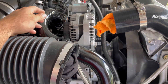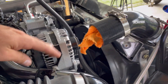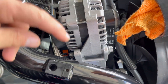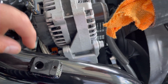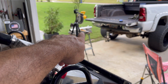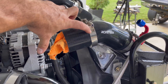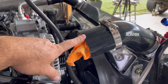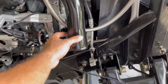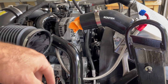They're all over the internet — they range from about 80 to 150 dollars. I'm going to cut that out and rotate it up. This MAP sensor is not going to work; I don't know why — this is for a stock Duramax and it's totally not correct. We'll figure that out. I'm going to cut a piece of five-inch piping — remember the stainless steel three-inch pipe I used for the exhaust? I'll cut a five-inch section so I can slide it up in here, then do a coupler from three inch to whatever this is — I think two and a half. I'll measure it once I cut it, because this extends out to three inch where the old intercooler used to sit.